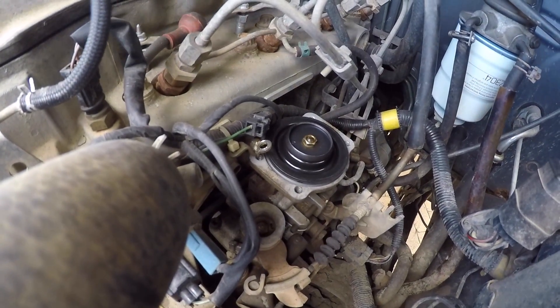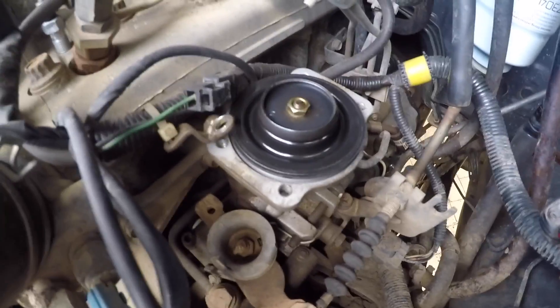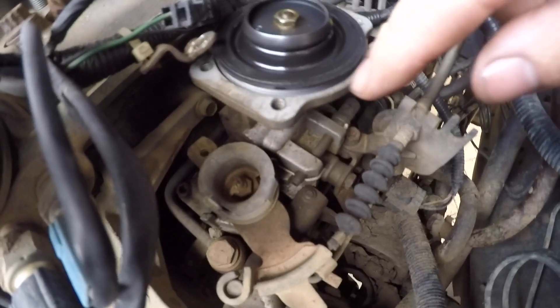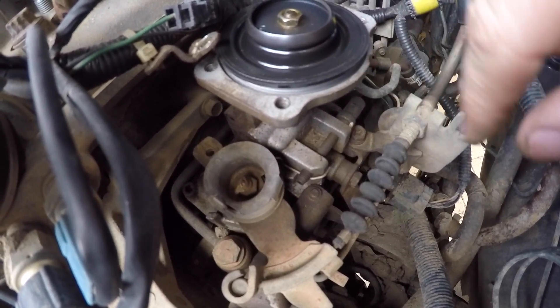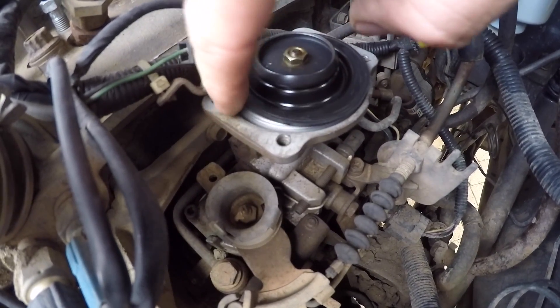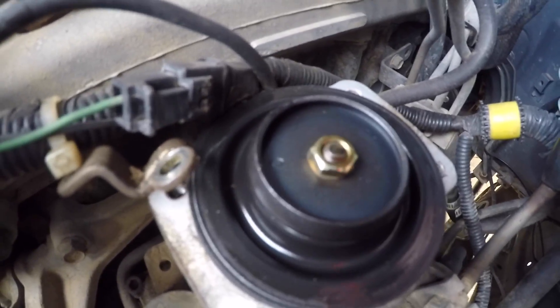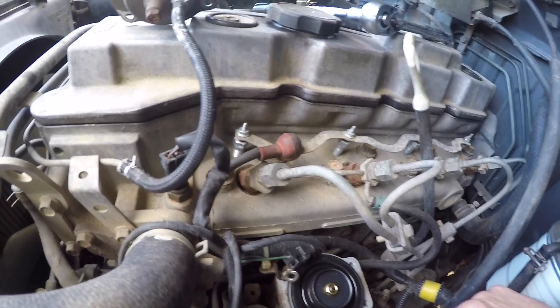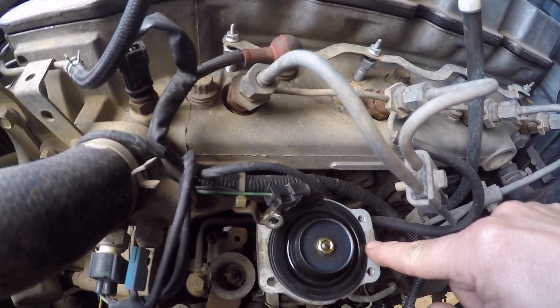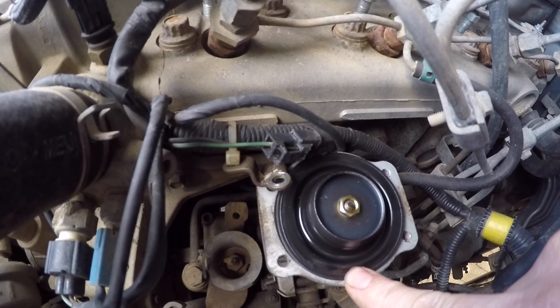Flip the top off and there we have the diaphragm. Now I've had this off previously because I was messing around with something, hence the diaphragm is up. But if it's not been touched for ages it's going to be stuck in there, so you're just going to have to prise it up with your fingers. Now you can see there's a zero on there — that is totally the wrong position. Looking at the side of the engine, the zero wants to be over here, sort of around the three o'clock position.